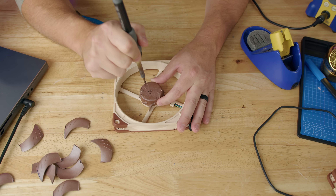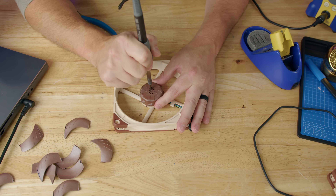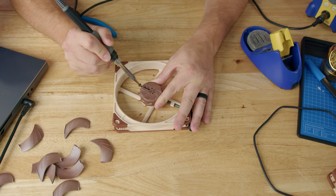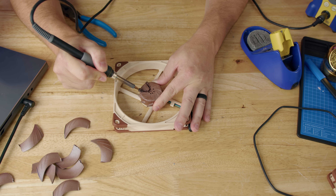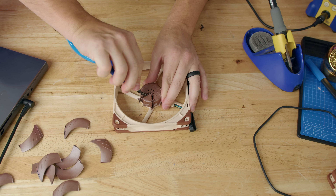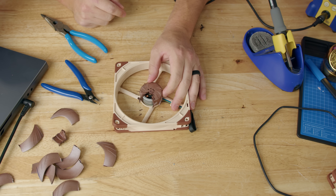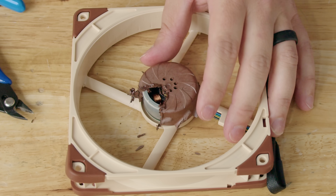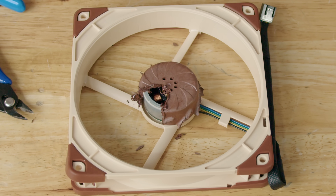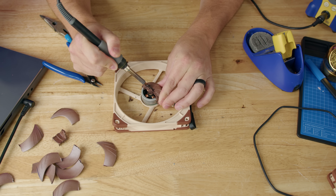We did not hit metal. So although this is inspired by the A12X25, it is different. We got to get a little farther in — there is metal, but I think we just got the standard ring that we see on a lot of normal PC fans. I cranked the soldering iron to its max, which on this one is 850. It doesn't seem promising. That's a real bummer. We essentially just have a ring, and the plastic hub is what attaches to the bearing — quite different from the A12X25. If I connect all these holes, this little plastic hub comes right off with that ring. This is basically how every generic PC fan is set up.